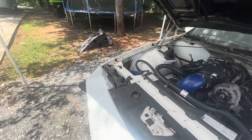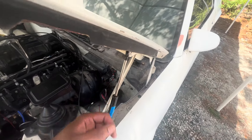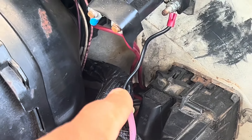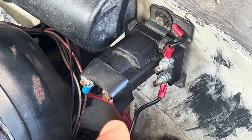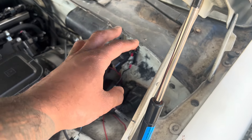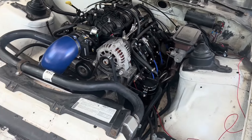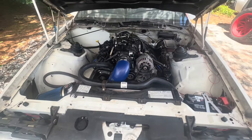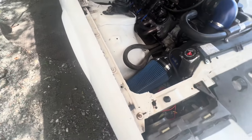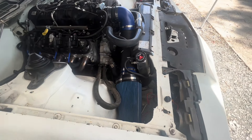Got the car back running. The culprit of why the car had stopped running — I'm gonna fix this today, probably only gonna take me 30 minutes. You guys see that pink wire right there? That goes to the starter, and they spliced into it to provide power to this distribution block right here. I'll be swapping that out, making it look a lot cleaner. The spark plugs were swapped out on the last video, and I put a 90-degree elbow on there with a four-inch cold air intake.